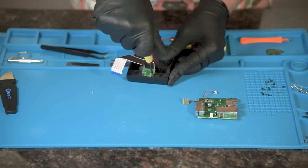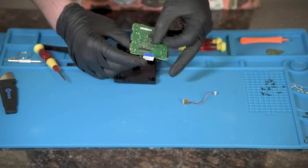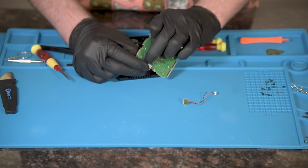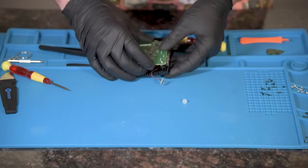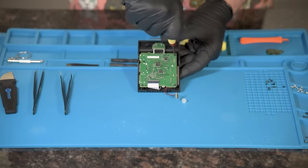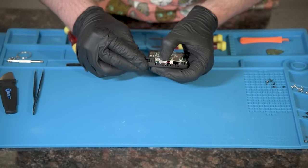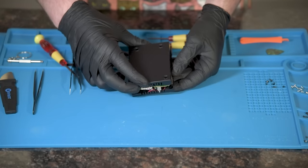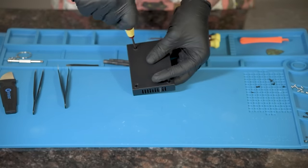Begin by placing that USB-C charge port cable in the top of the new shell. Take the power board and input it into the charge port cable. Input the LED board. Put the power board in the slot and screw in only the three screws located closest to the front. The placement of the plastic LED cap is more or less up to where you want to place it. I like to slide it in one of the vent slots and place the board behind it with a thin piece of tape.